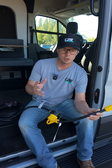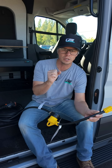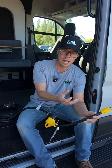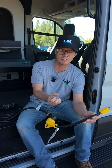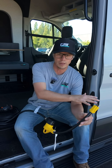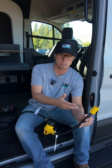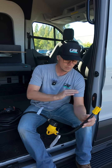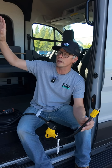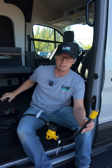So you're pulling a ton of energy through a really small cable, which is kind of like forcing a bunch of water through a small hose — and that is dangerous. What happens is that increases resistance, which is then given off as heat, and so you're at risk for fire or damage to the system, the breaker, or the house. We would never want someone to start a fire because they used the wrong size cord by accident. So regardless of what kind of van you have, before you plug into an extension cord, think through that process, turn down the energy level, and don't make the cable too long.